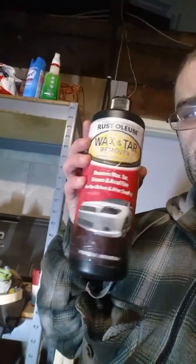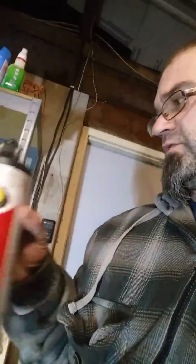It's not hard when you paint. Remember to use some type of adhesive and wax remover — this is what I'm using, tar and wax remover. It also gets adhesive off. It does really good. Let it dry for a little bit of time, and then when it's dry, shoot a nice thin layer of primer. Then go back over it with a little bit of a heavier coat, but not too heavy. Then let that dry.